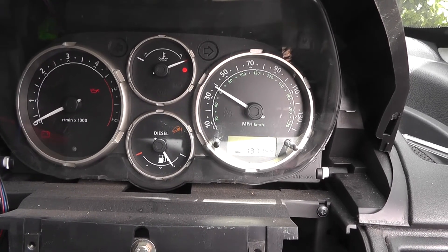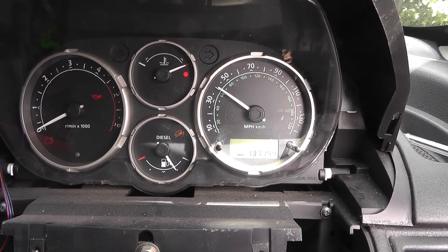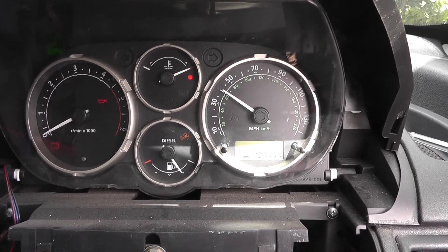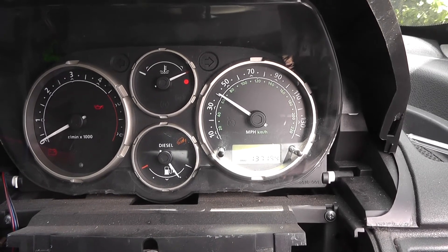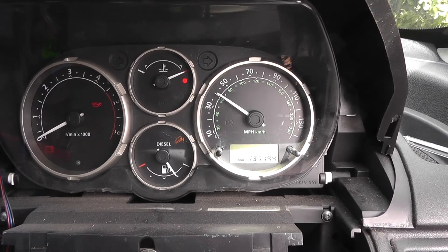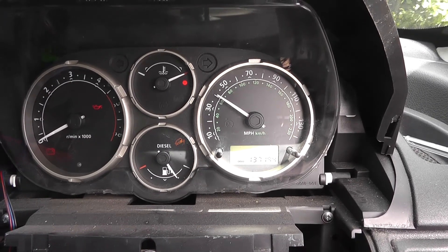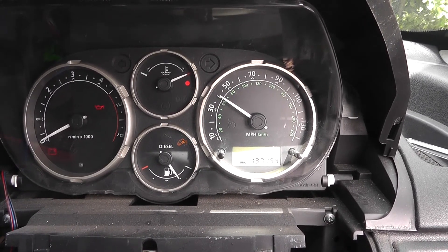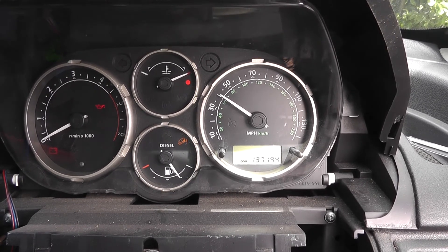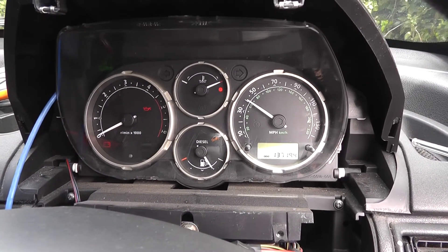Hopefully the ABS unit will remain connected. The ECU will probably have to be disconnected from the system, because with the ECU running there's so much CAN traffic bouncing around that it conflicts with the CAN signals I'm sending and causes problems. So I suspect we'll have the ABS connected to the dash and the ECU disconnected — at least I think that's the way we're going.